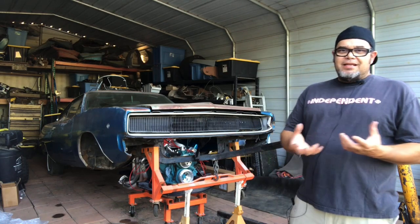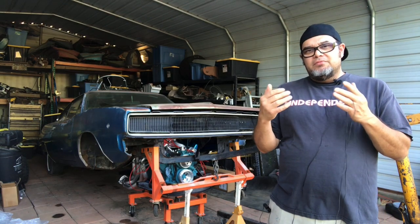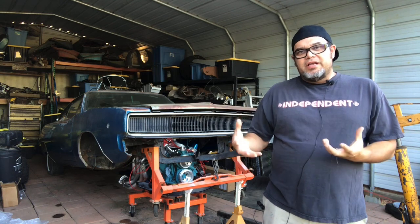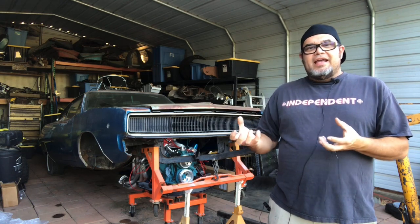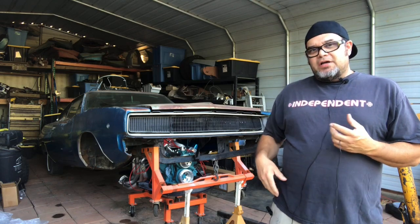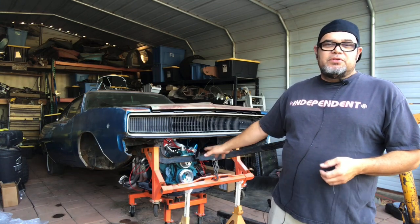Unfortunately, the way we designed that dolly, we have a bracket that attaches to the bottom of the block where the transmission meets it, and the headers hug the block and tranny so close that you can't get that out. So I can't tighten the headers until I get that piece off, and I can't get that piece off until I bolt the K-member to the car.